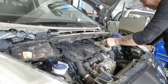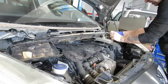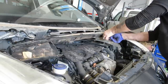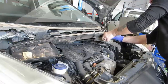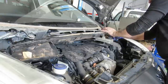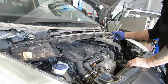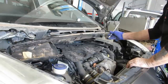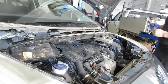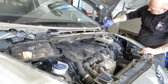Yeah, two 220s. I've got two little locating slots. Slide them in. Jack screws, and again, going in plastic. Don't over tighten them because it'll just strip them out. Just to feed them. That's all you need. Forward there. So where that trim locates, all along here, throw a little screwdriver along it gently. Get all the crap out of it.